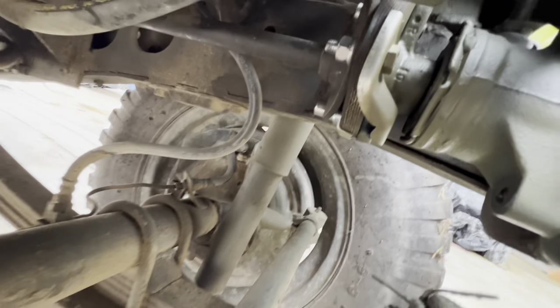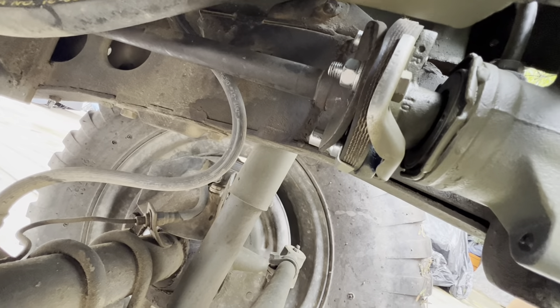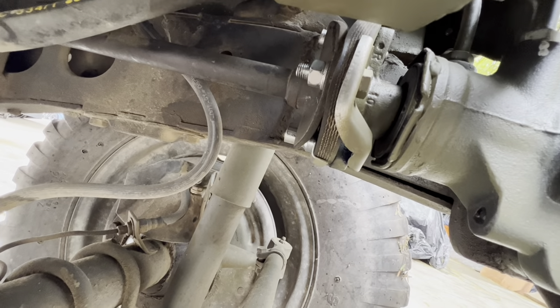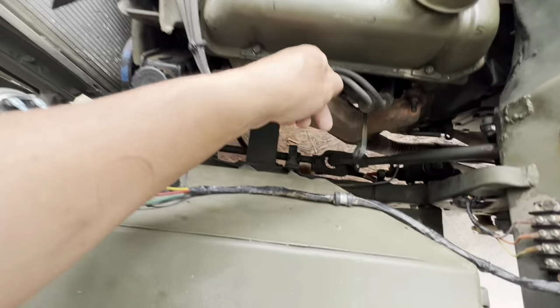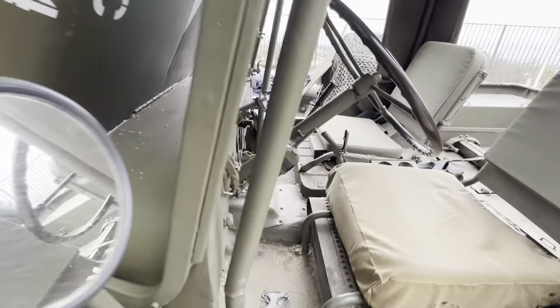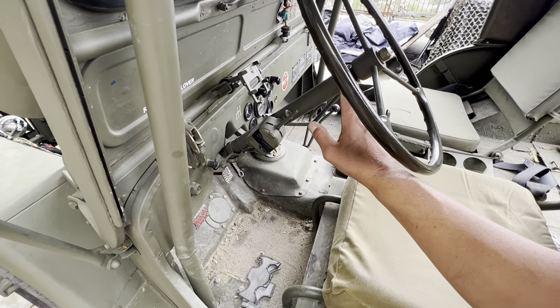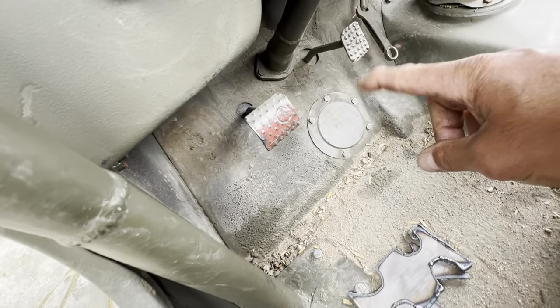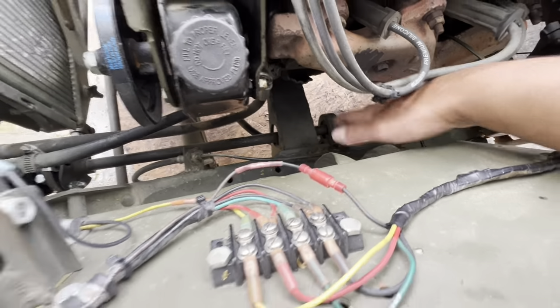You can see my three-quarter inch driveline right there — steering wheel, I think it's a double D. That's a GM part from Speedway — three-quarter inch double D going into my joint here, onto a one inch. It comes right up. I used the old Willy's sector shaft that was on here, cut it down, and made it fit right with a bearing and a flange bearing down there. I installed a pillow block bearing here so it secures it really nice.